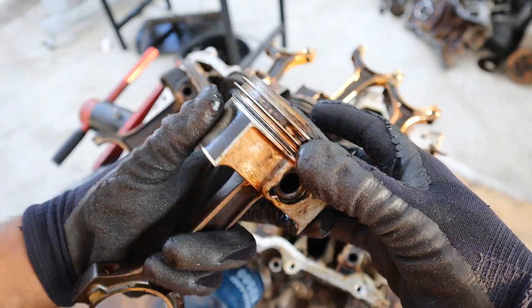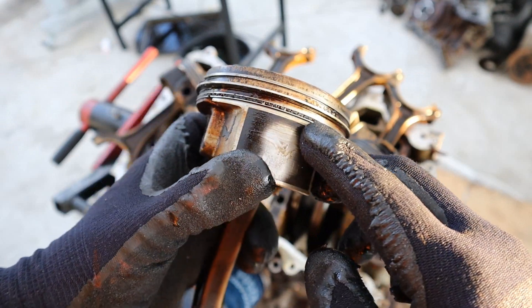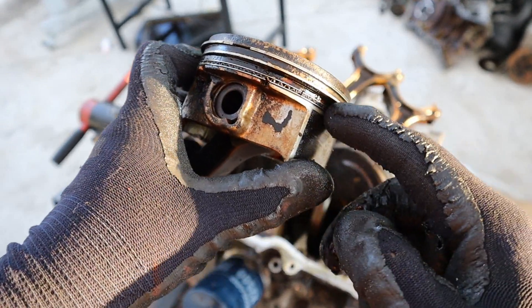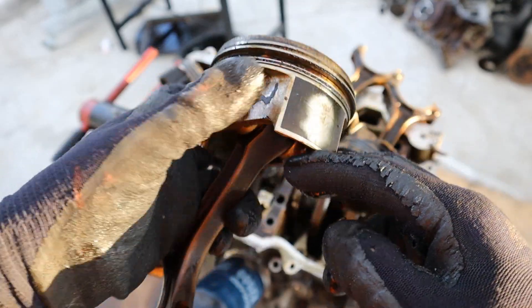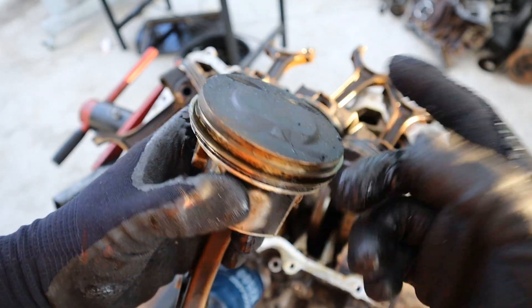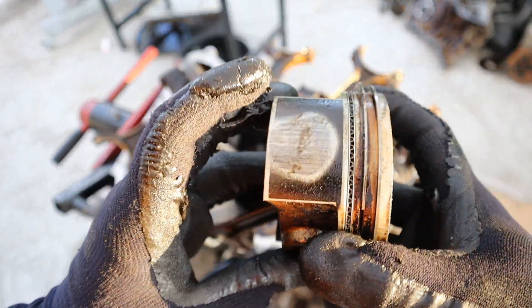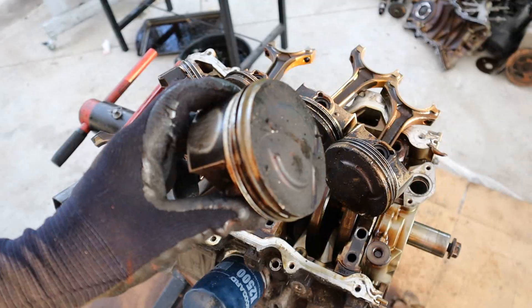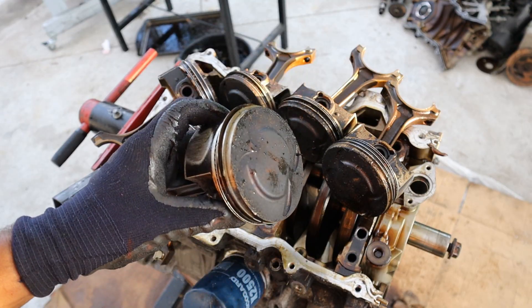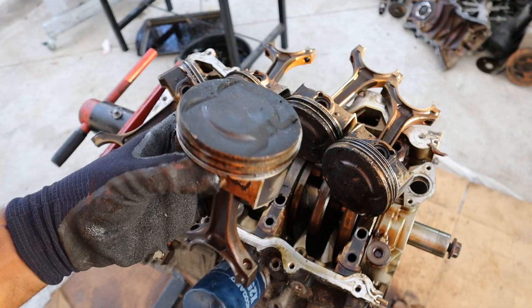Things don't look very well — you can see there's a lot of carbon built up around this piston. The worst part is really the oil control ring at the bottom, which is supposed to be nice and corrugated to allow oil to flow down underneath the piston on the down stroke. But if they're blocked up like this, all of the oil is going to end up on the top and just get burnt. This engine was definitely burning oil. You could also see a little bit of skirt wear on the outsides. This is why swapping in a used engine is kind of a risk — you don't really know where you stand with things like oil burning and head gasket issues until you actually install it.